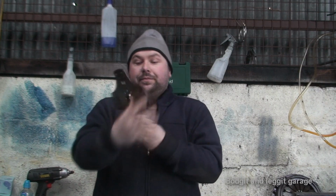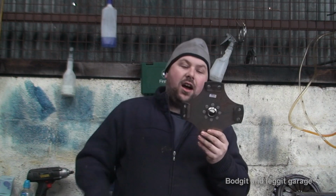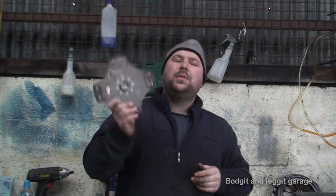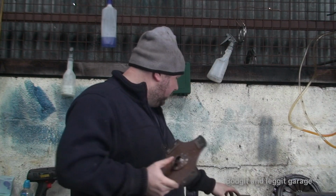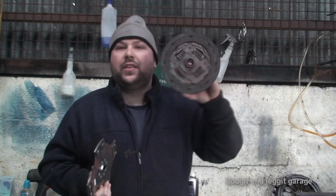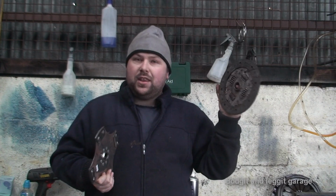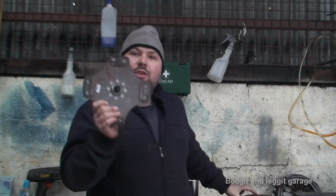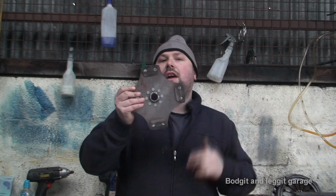But again, these are very severe. The pedal is a lot harder and you will destroy your flywheel. Well, I wouldn't say destroy your flywheel. Depending on how you drive the car, most flywheels on a normal clutch will last the life of the clutch no problem. It's only best, if you're replacing the clutch, to replace everything, because it's just easier and safer. With this, you'll mostly find this will last twice as long as your flywheel.